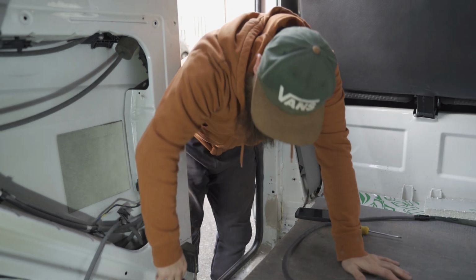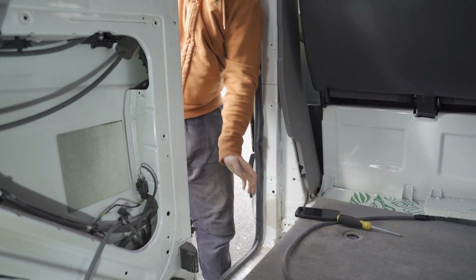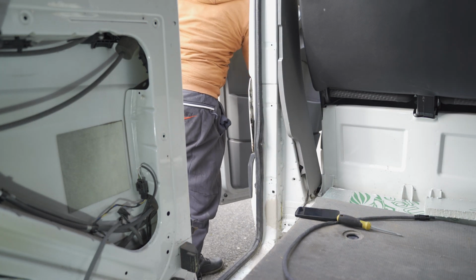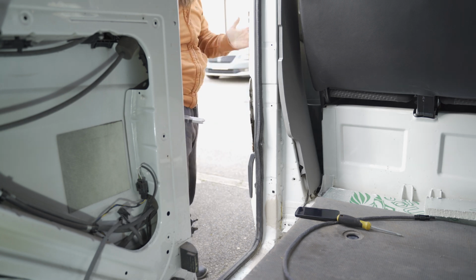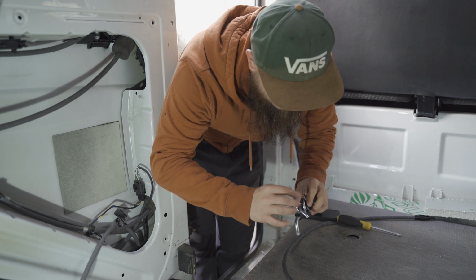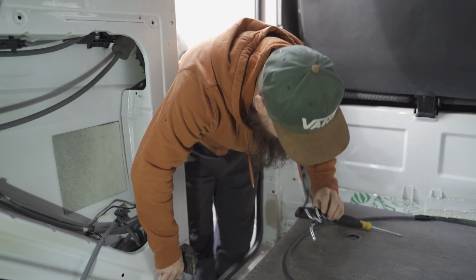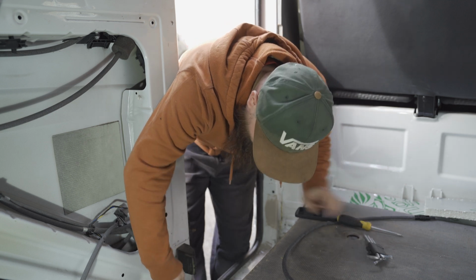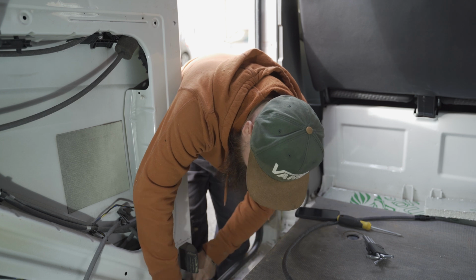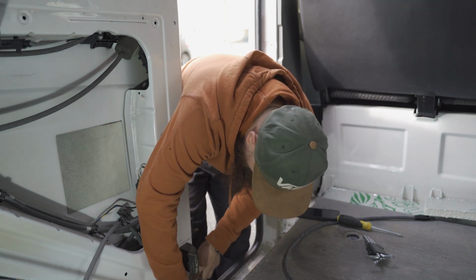The plastic will not clip out unless you undo these 2 bolts. So the clip is fixed here, so let's get going on that. Doesn't look like it's going to be as easy. Joke. It's quite easy. So it is a T30. These bolts look like they've not seen any rust, so let's hope they undo quite easily. Yes, they do. Of course they do.